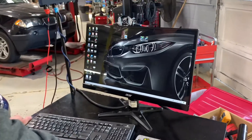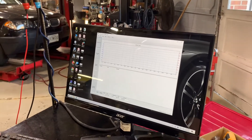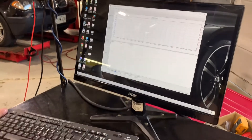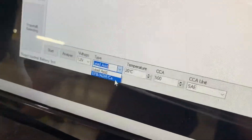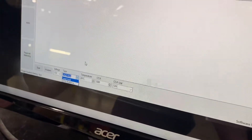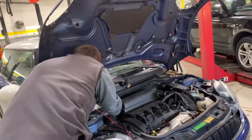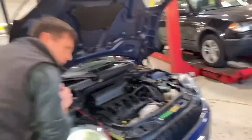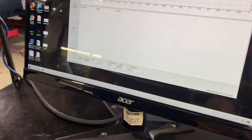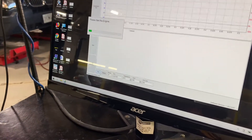Go to PicoDiagnostics in the left corner. At the bottom you just pick the battery voltage, what battery type you have — AGM or lead acid — the temperature depending on which area you're in, and CCA. We got 650, so I'm just putting 650. It's a regular battery, lead acid, and just hit the button start.